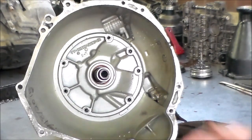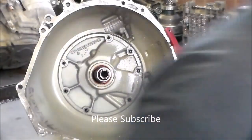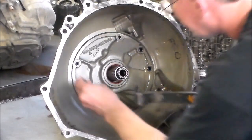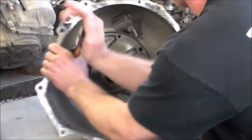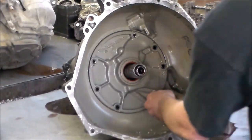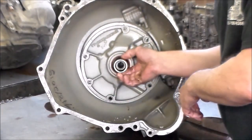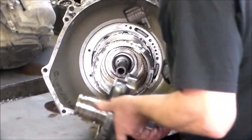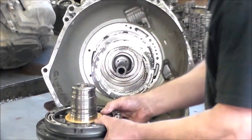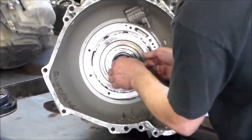Let me get my bar here and see if we can get this pump out and just chunk this down, then we can continue tomorrow and look at everything. Pump out. Your intermediate piston and return spring. Intermediate clutches — I've got some burn spots. I've got a banner kit which I already have.